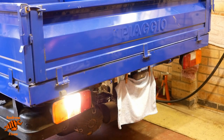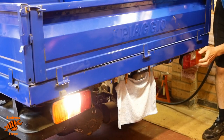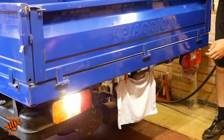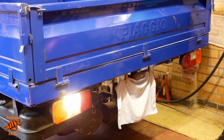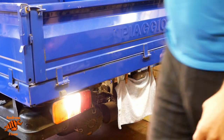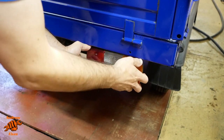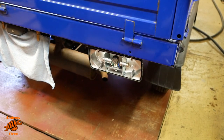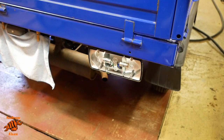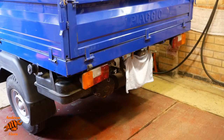Putting it in reverse — we have got a 50% success there. Sometimes they only bother fitting reverse lights on the near side, the side next to the pavement. But I suspect we've got a bulb gone there, so let's have a quick look. There is indeed a bulb in there — it doesn't look happy, does it? I told you I'd missed something.